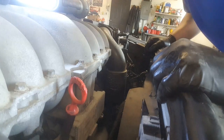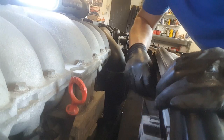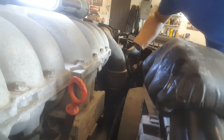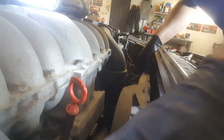We got all our bolts out — two up top — we've got our EVAP hose unattached from the fan shroud. The fan shroud is unplugged, all the other wiring is off it, the EVAP purge solenoid is just off to the side and disconnected from the fan shroud. Let's get this fan shroud out of here.